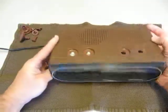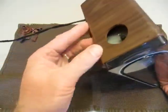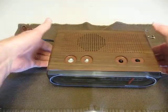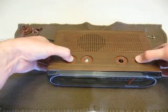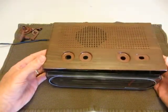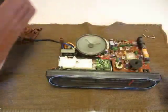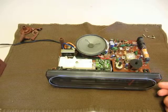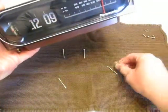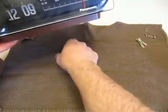Like I said, when you turn this over, the best way to lift these cabinets off — you see the cabinet edges right here. You don't have to really stick your fingers in there, just pat your fingers there, place your thumbs here and start to push. Obviously I did get that screw. This will lift right off. You can go ahead and set the cabinet top aside. The screws should have fallen out — there are six cabinet screws.